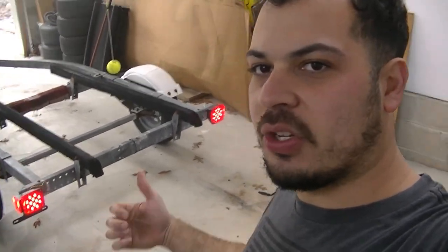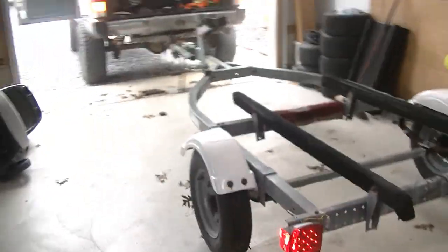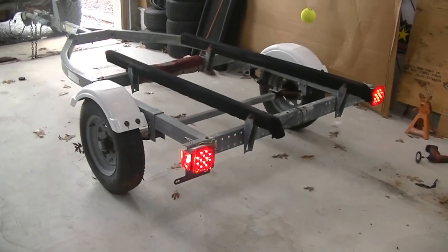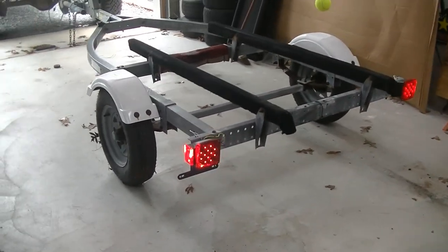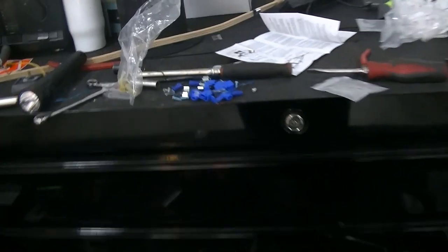I hope this video helped you rewire your trailer, whether it be a jet ski trailer, a boat trailer, or a utility trailer - it's going to be pretty much the same regardless. I'll post the link to these trailer lights down in the video description - I bought this kit on Amazon, and if you do buy from those links it helps the channel out greatly. Please like, share, and subscribe. The main takeaway: if you're doing this on a boat or jet ski trailer, definitely do it the way we did it. Don't use anything that's not waterproof - don't use wire nuts, that's just asinine. The kit actually comes with wire nuts, and those other connectors in the kit aren't watertight either. Always use watertight connections - the wiring will last longer, the lights will last longer. Like, share, and subscribe. We'll see you next time.